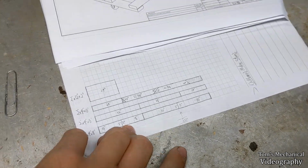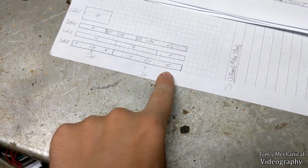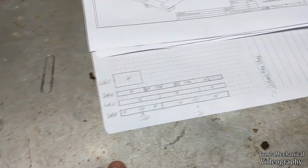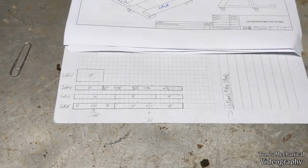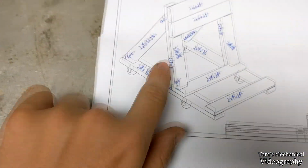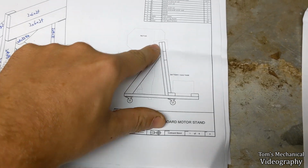And I figured if I drop these down to 30 inch, or 29 and a half if need be, but I think 30 inch will be fine, I can cut all 4 of these boards out of one single continuous 8-foot 2x4 and not lose any slop. And also the height of these 18-inch boards is dependent on the height of these, so I could take a half inch off of everything if need be, as long as I'm taking an even amount out of all the boards. Like, I could drop these down to 30.5 and these down to 17.5 and it'd still work. And that's the height of these 2 boards right here that then holds the mock transom, which then mounts to this board and that board right there. As you see, it doesn't mount at the top, so it doesn't really matter if this loses another inch.